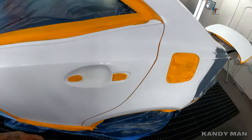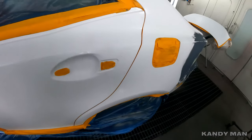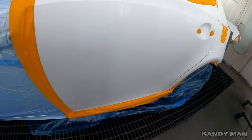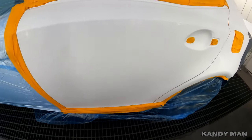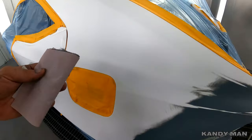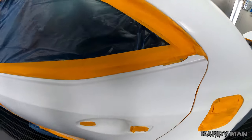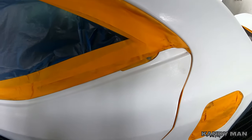It definitely gets the dirt out of the scratches. You guys know as well as I do — if you don't get your blend panels clean before you put that pearl on, you'll end up seeing it and have a spot where you didn't clean it good. So I've been wet sanding them, because no matter what, when you try to clean it without sanding first, you can't get that off of there.